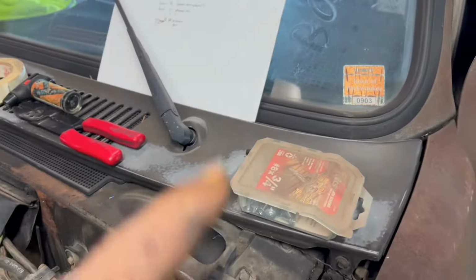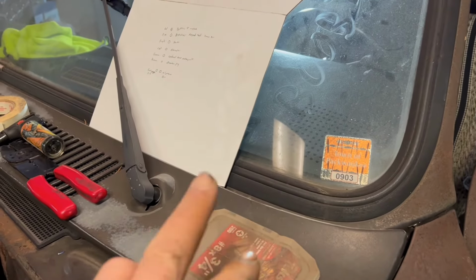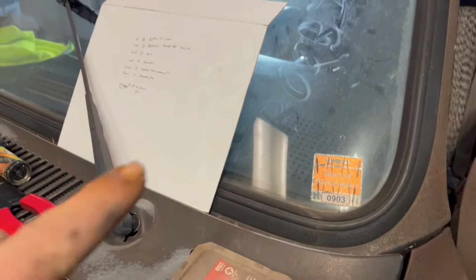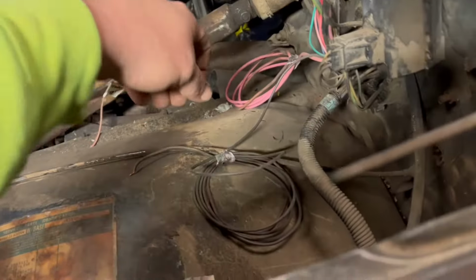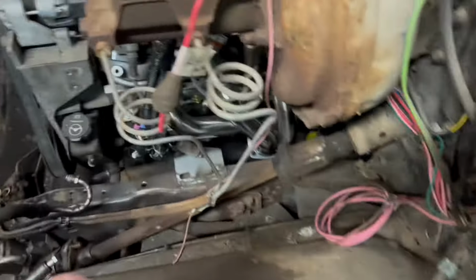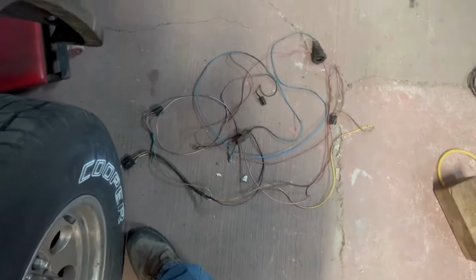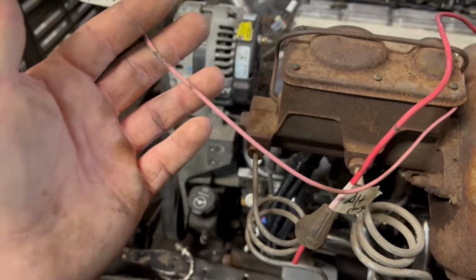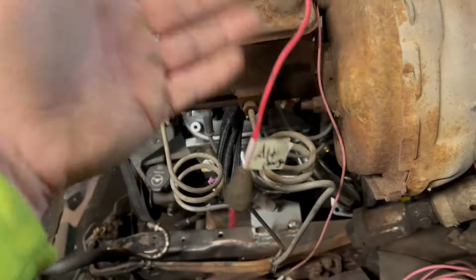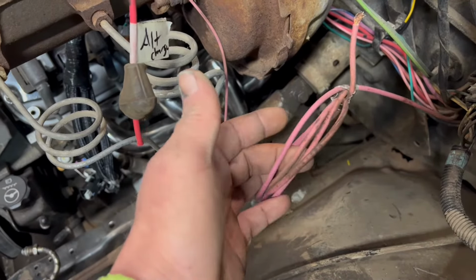And with the gauges that we put in this, the voltmeter gauge doesn't need that other power wire, that brown wire that's in there. So basically the brown wire that everybody uses to trigger the alternator no longer will work for me, so I cut that out. I'm going to use this pink wire to trigger that. I don't exactly remember, out of all the excess wiring I cut out, what that went to. Oh, that went to power and oil pressure. Either way, it gets 12 volts. I can put that 470 ohm resistor in it to bring that down to the 5 volts for the trigger wire.